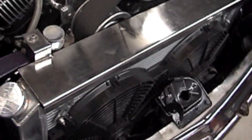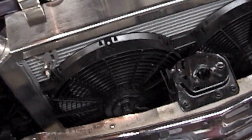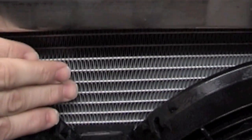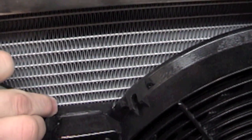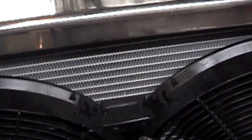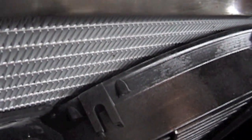Here's the B-Cool radiator. It's actually a really nice radiator, and the thing I like is when I opened it up in the box, all these fins looked just like this. I had maybe one or two that were slightly bent, just a little bit. Let's talk about fans for a second. B-Cool recommends that your fans stay about a quarter inch off of the radiator fins.